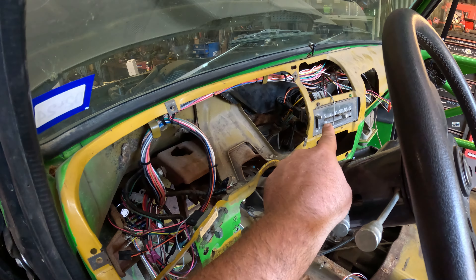Still have to hook up the check engine light wire that goes to the box, and a couple of wires - that's all it takes to make the LS harness run, just three wires. Hopefully this blazer drives out of the shop today. This is taking way longer than I thought. I mean, this is way better than trying to build a harness on your own, everything's pretty much cut to length. The biggest issue is they try to make it so universal for all Chevy stuff that the plugs are on you - build your own plugs - and everything's way too long because it also has to work for a long bed, so you have to trim everything down.